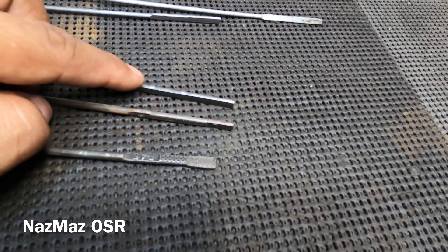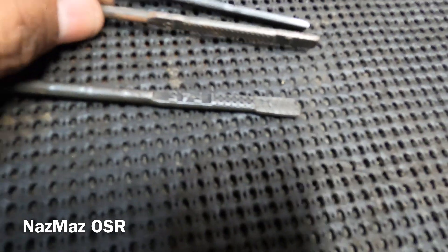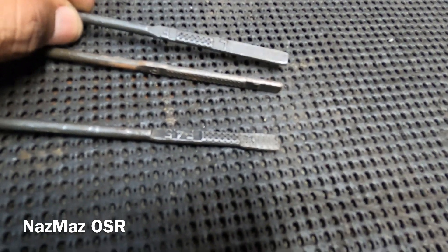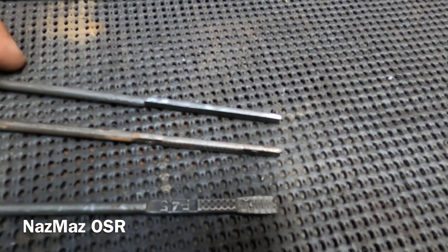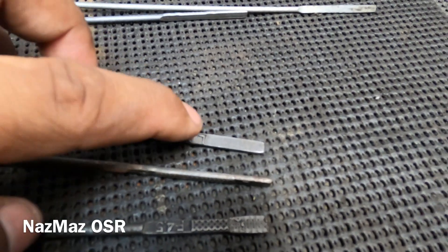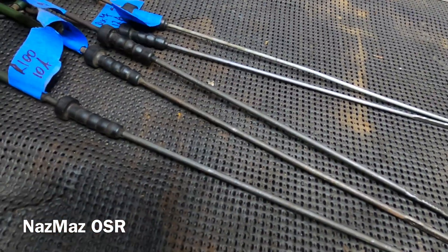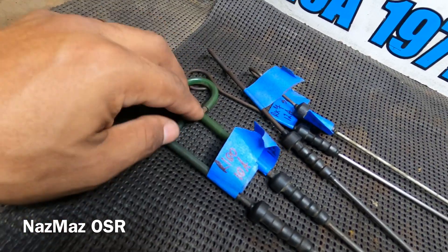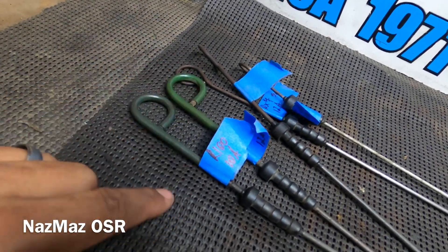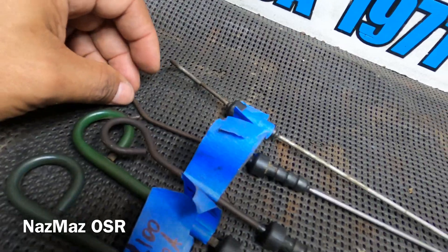Moving on - this is the old school 13B and the twin dizzy 12A. These are pretty interchangeable here. The full level is right on the rim, same as the 12A. However, the low level is quite different - the low level on an old school 12A sits way down here, while the big-letter 13B sits up higher. It will give you false readings if you switch them. For the earlier rotary engines, right at the hook where you pull them out they look very similar - colors are a bit different but very similar - so it's easy to get them confused.